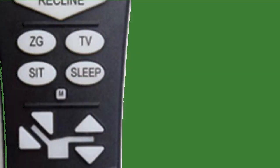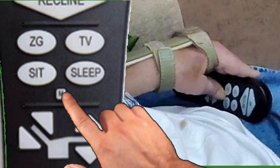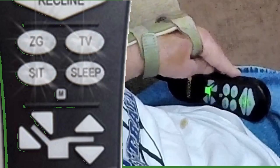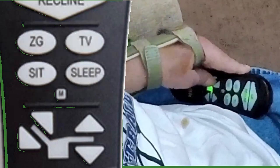I've sensed from my discussions that there are few people in my viewing audience who are afraid to make any changes from the factory setting. Fear not, as Golden Technologies provides you the opportunity to quickly and efficiently return all of the position controls back to the factory setting. On my auto-drive controller for my PR535, all I have to do is press and hold the program button. The controller's backlight goes off while the button is pressed. In about four seconds, the backlight will start flashing. Within five seconds, press the back rest down button. The backlight will change to non-flashing.